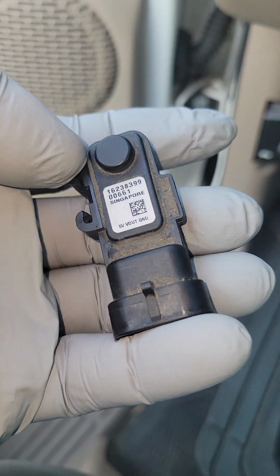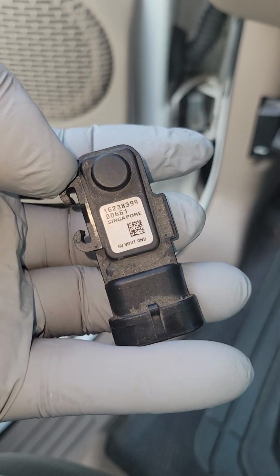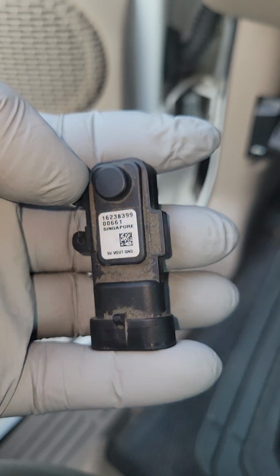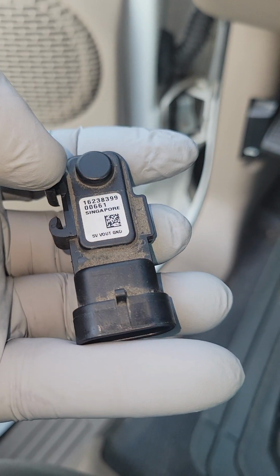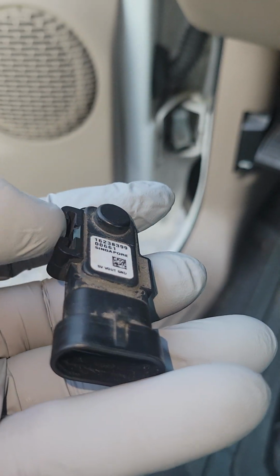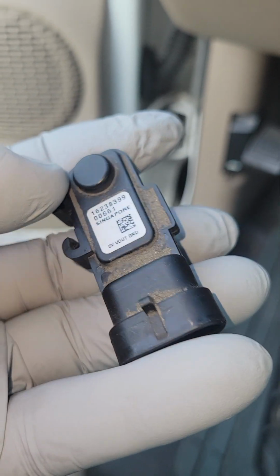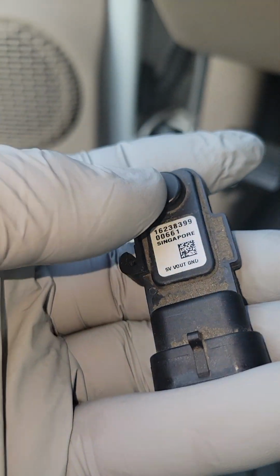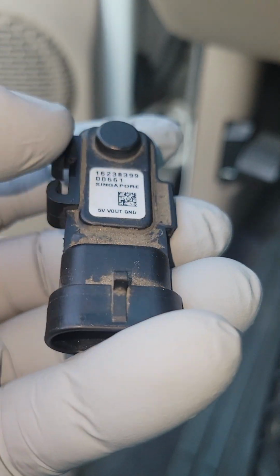This sensor sits on top of the fuel pump assembly, and you can access it from the driver's side of the vehicle right behind the gas door. All you need to do is go down below and follow the filler neck hose underneath the vehicle. To give you an idea of what you're dealing with, turn your camera on, turn the light on, run it back there, and try to get yourself a picture. It's a tight spot for the camera, but there's more than enough room for you to stick your hands back there. That will at least give you an idea of what you're working with.